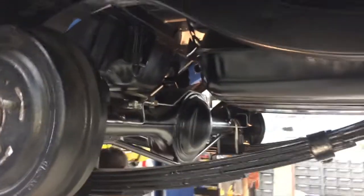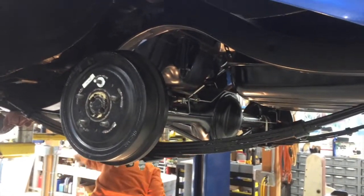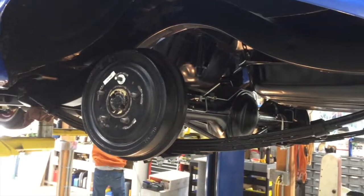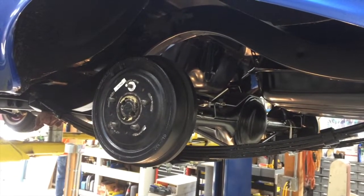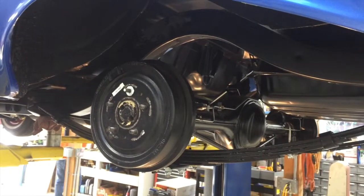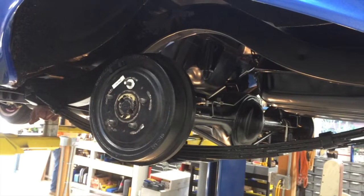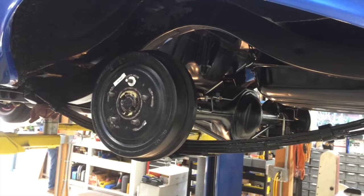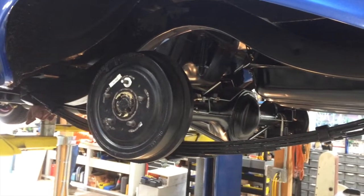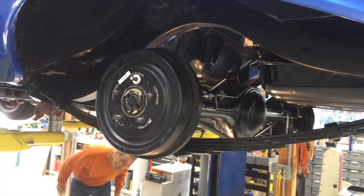Yeah, really. This is the current fun job we find ourselves in at this point, since installing new rear shocks led us to the decision that we needed to put a crossmember up there, get rid of the original mountings, because the shocks that are the original specification don't let the rear end hang far enough to put the tires in and out, you know, everything new.